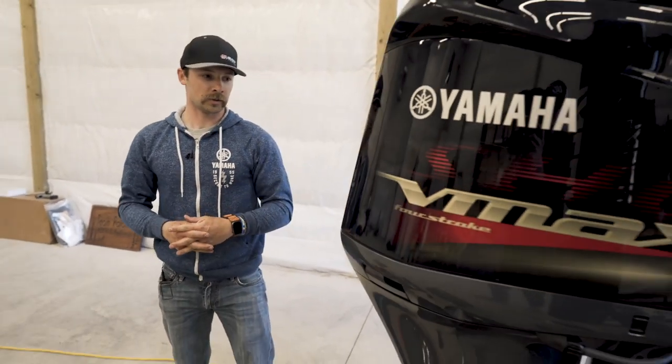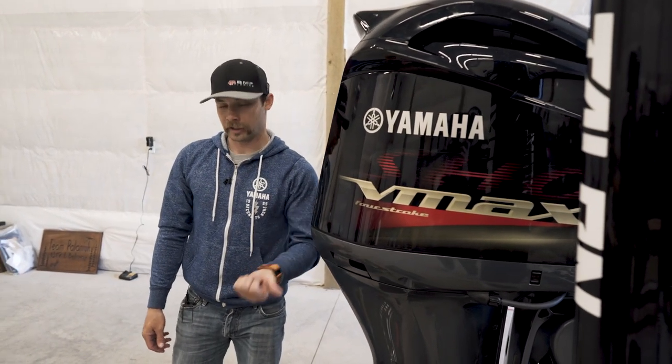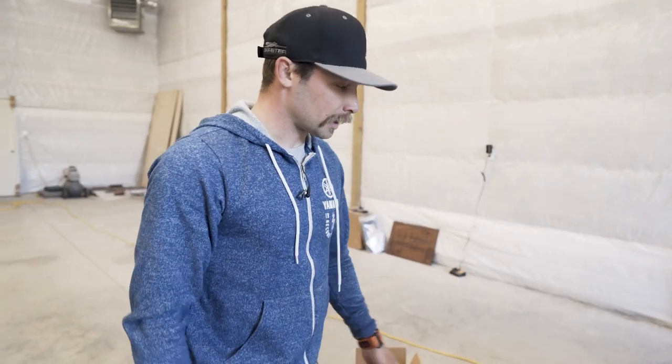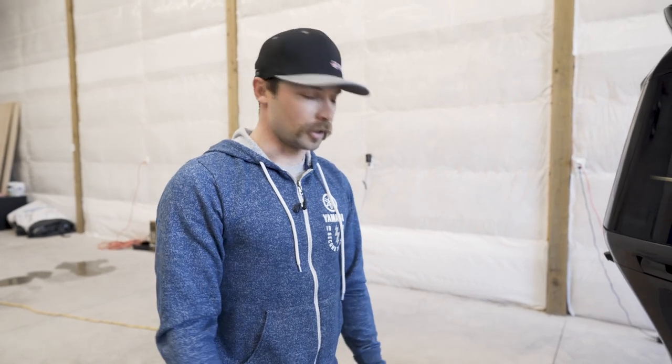That's how quick and easy it is to change your own oil. Make sure you guys pick up that oil change kit from your local Yamaha dealer or online at yamahaoutboards.com. Clean up your motor before you go dump it in the water — get all the oil off and make sure you properly dispose of your oil. You can take it down to Walmart or any auto parts place and they'll recycle it for free. Thanks for watching — we're going to change the gear lube next, so click on that and learn how easy it is to change the lower unit gear lube in your motor too.